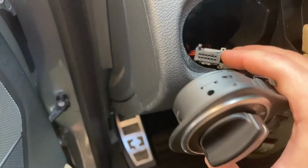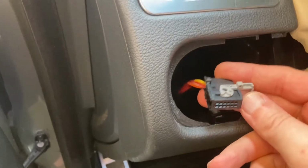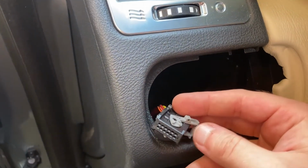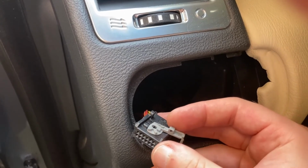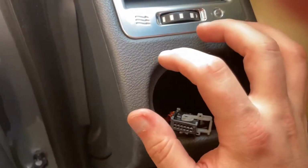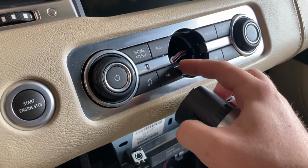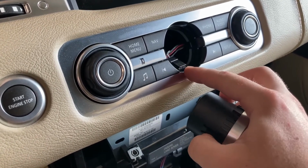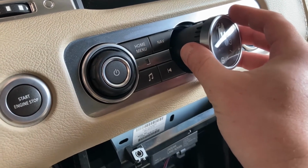Add the electrical connection. Make sure after you put it in place to twist this gray pin. This makes it lock into position, and then push it all the way back in its block until it clicks. And finally, with the clock, again straightforward, connect it with its corresponding electrical connection, and it can be then pushed back into its block until it clicks.